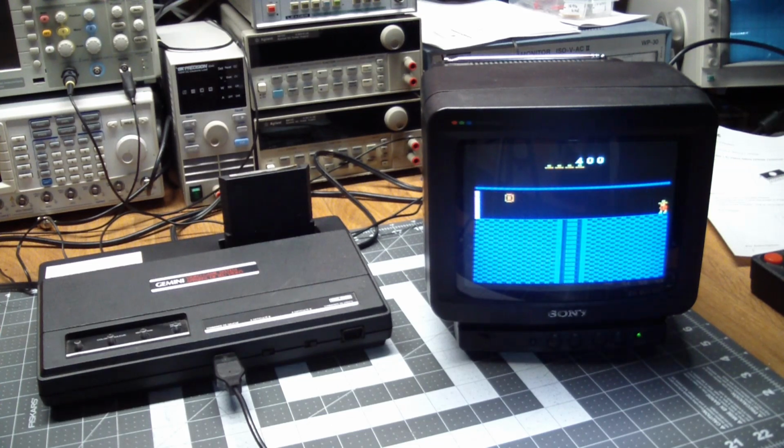So we have to find a way to take those ROM images and have some sort of a cartridge that we can put EPROMs into, that we can program ourselves. Now again, there are several of those available for purchase, already made. They're ROM carrier boards that are wired so that you can put an EPROM into it, and you burn one of the images that you want to play, you stick it in there, and everything's fine. But again, I got to do it the hard way.